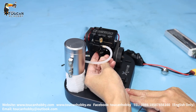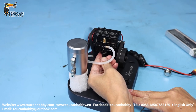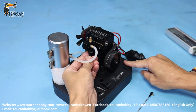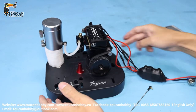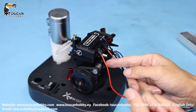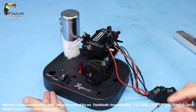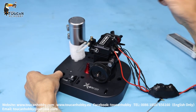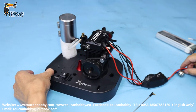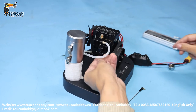Let's see this side — this tool is the exhaust, and it could already be very hot. You see the exhaust has some oil, not fully burned, meaning the oil going inside is still a little more than it should be. But I already closed this well, so really this carburetor needs more adjustment — maybe open all the needle and do some finer adjustments to let less oil go inside.